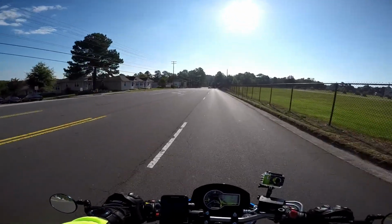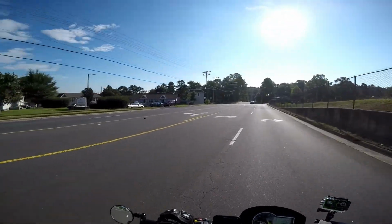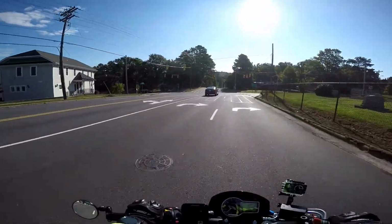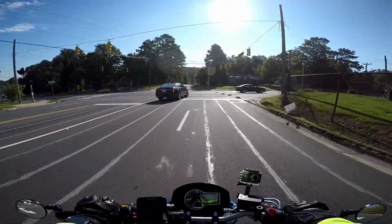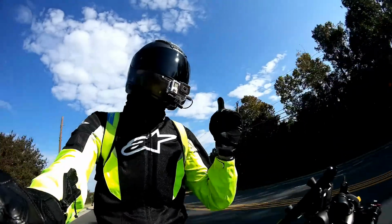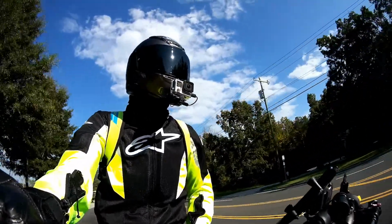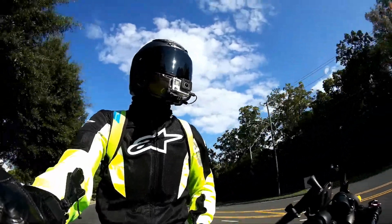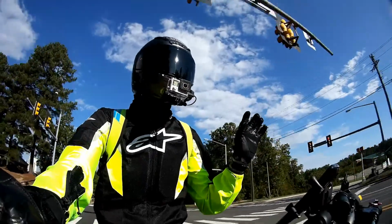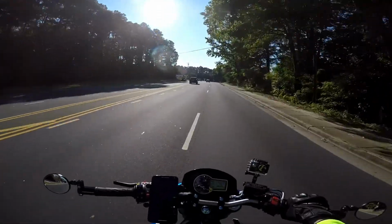So it turns out that Yoshi, for whatever reasons, government regulations, because it had to be sold at a dealer, I don't quite know why, but they welded that screw in place. Just a little tack weld, nothing crazy. So it actually took some chisel action and all that, and I finally got the darn screw loose and was able to then easily slide the baffle out, or DB killer, whatever you want to call it, and oh my goodness, what a difference that made.